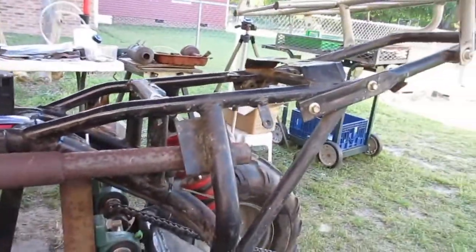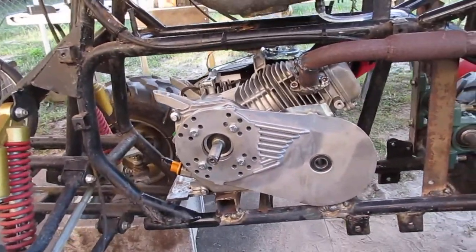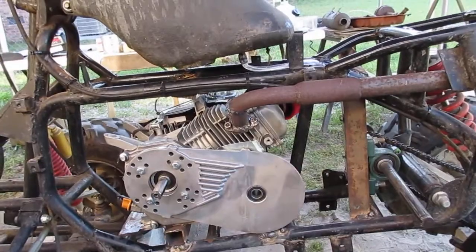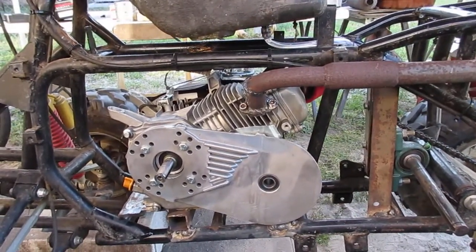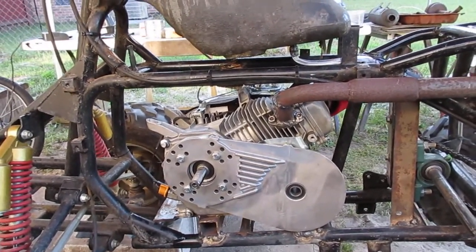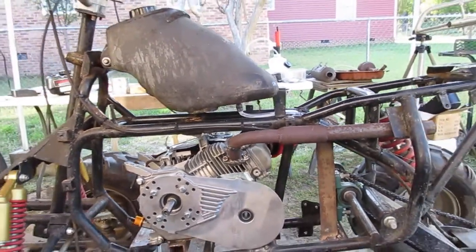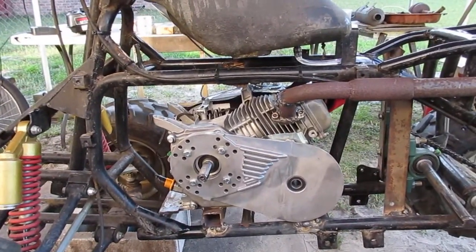Anyway, she's coming along — put oil in it. The old Grasshopper gave me this motor and I really appreciate Grasshopper, you don't know how much. He had 5-30 in it, and I read up on small engines — summertime, 5-30 is only good to about 80 or 90 degrees and we hit hotter than that, so I got 10-30 in it now. I'm gonna run 10-30 for a little while.